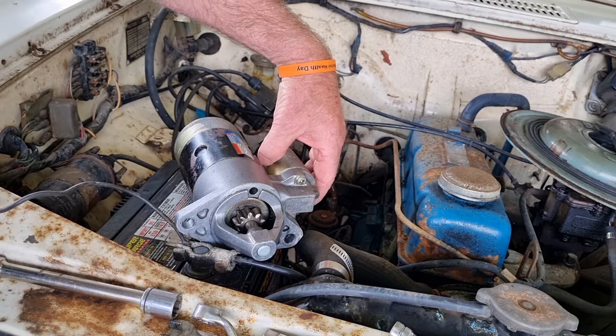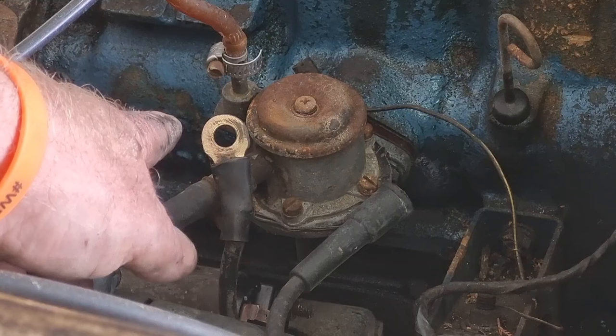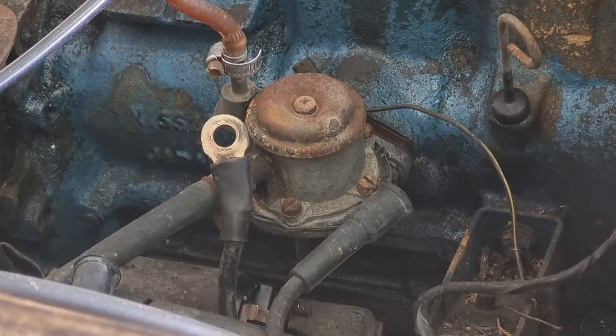As a bench test it seems to be working. Whether it engages with the ring gear or not is yet to be seen. I got the starter motor back in - literally took about five minutes. I'm cleaning up the wire that goes from the positive terminal of the battery with some sandpaper and brake cleaner. Brake cleaner is a great cleaning agent that doesn't leave any residue. I'll reconnect that and see if it made any difference - it'll either engage or it won't.